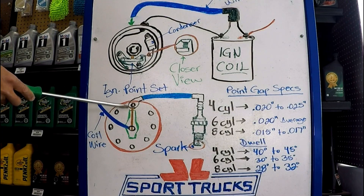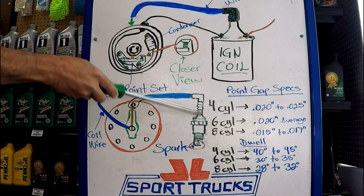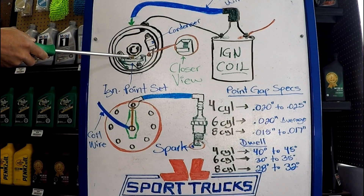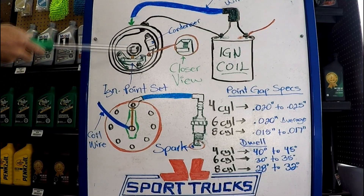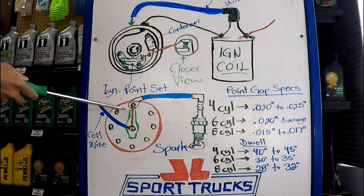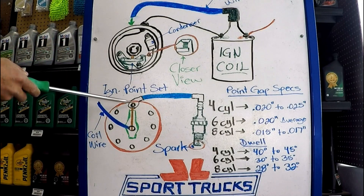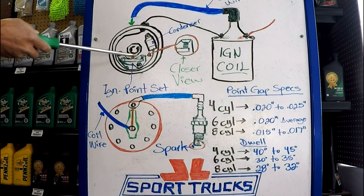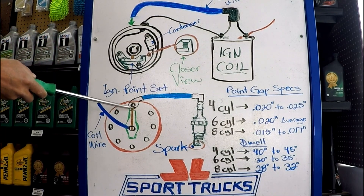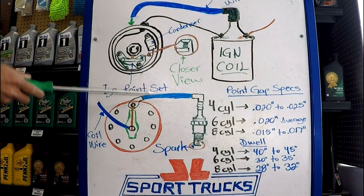Just a quick clarification: the pictures drawn here show when the current is being sent through the rotor to each spark plug — that would be when the point set is riding on a cam lobe. So if these two pictures were to match, the rotor would be somewhere in the middle. I want to make that clear so you're not confused. If you've never seen a points and condenser distributor, don't think that when this part is sitting on the flat part of the cam is when the rotor and plug wire would be aligned — that's not the case. These are two different pictures during two different times of distributor rotation.